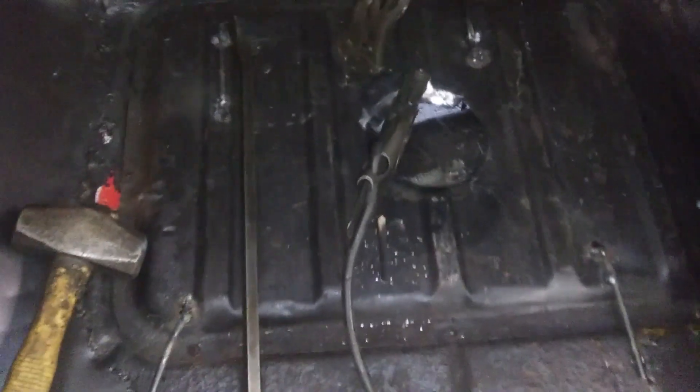The two end straps are pulled through — basically it goes around the fuel tank, then I bent them at 90 degrees to go over everything, just in case the top of this tank gets weak and breaks; at least the wire will hold the tank in place. I got it stuck through the two holes I drilled, then used a pry bar to put tension on the strap. Once I have tension on it, I weld it all the way around, and while the rod is still hot I bend it over. I'll cut that down and use sealer to seal it.